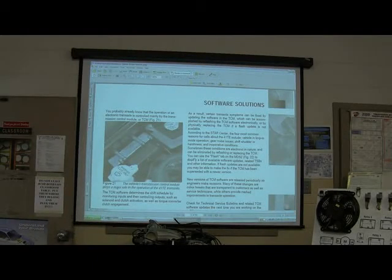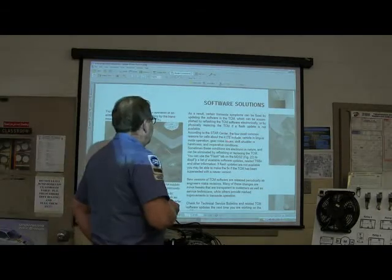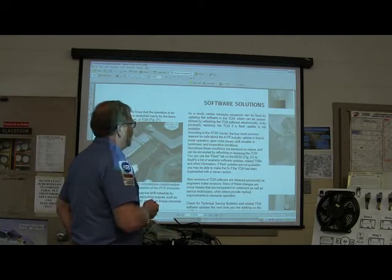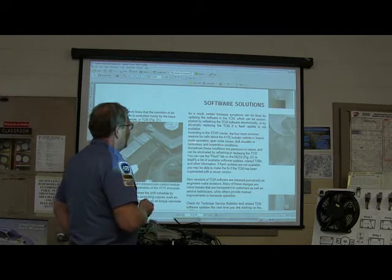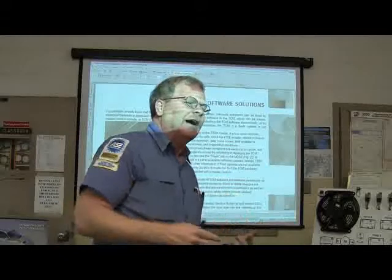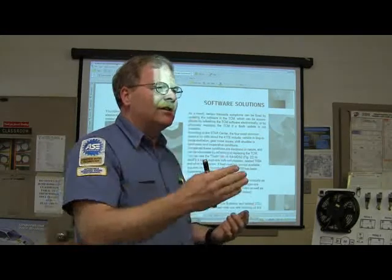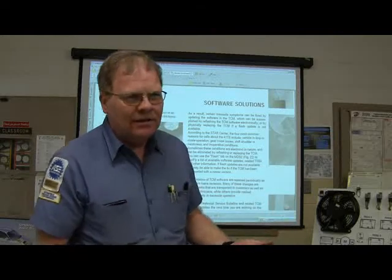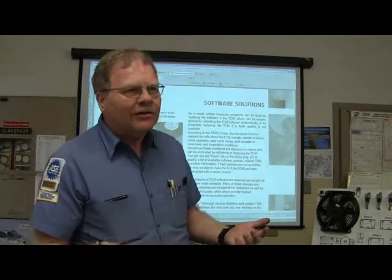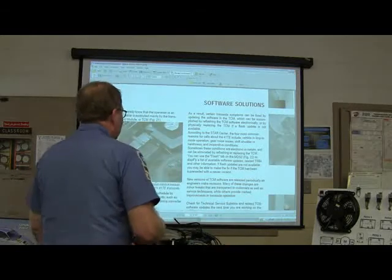All right. Now, according to the STAR Center, which is where they keep the database up there, the four most common reasons for calls about the 41TE include vehicle limp-in mode operation. That is the mode it goes into when there's a problem and it can't work right, and it changes into a mode of operation where it doesn't shift gears, it's just in one gear, so you can go places, but you're always in third gear or something. When you take off, it doesn't take off all that good because you're in too high of a gear, but it's a limp-in mode.